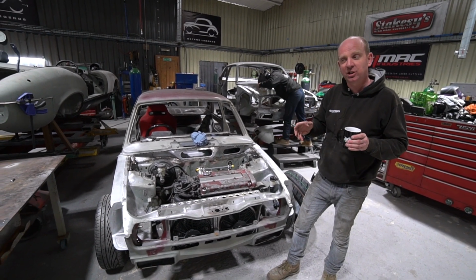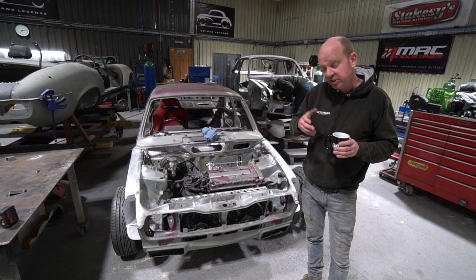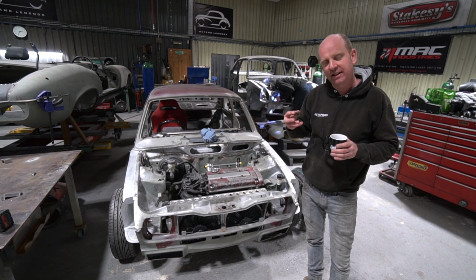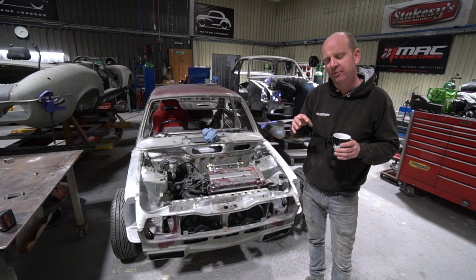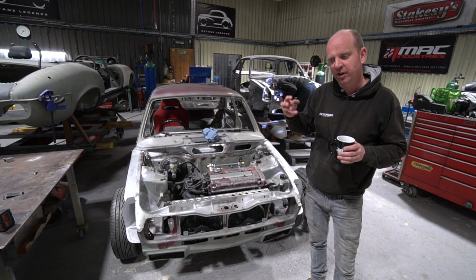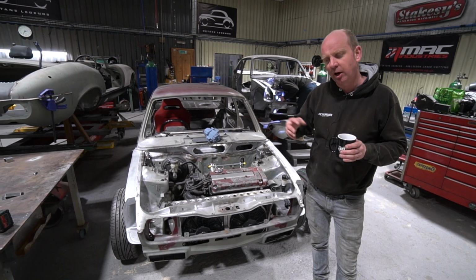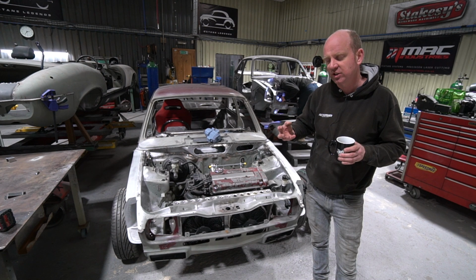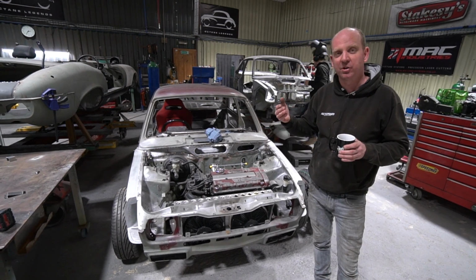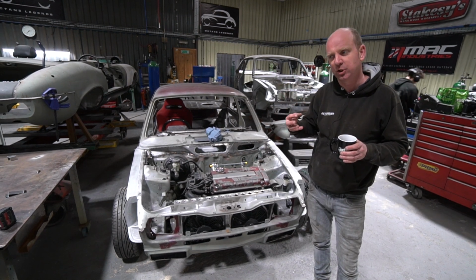I thought I'd mention it because a lot of people wouldn't be aware of the possibilities there, because I certainly wasn't aware that there was a readily 3D printable material, that was even reasonably affordable, that would withstand 300 degrees-ish in an autoclave. Or I don't think the cure temperature is quite that high, but between 200 and 300 degrees C in an autoclave. So that's really good news, really helpful for us, and hopefully that's something we'll be able to do on some of our builds going forward, because it really will make for a really neat solution.